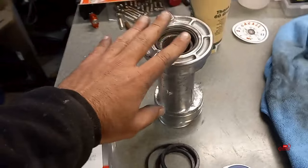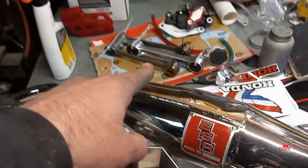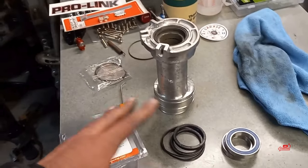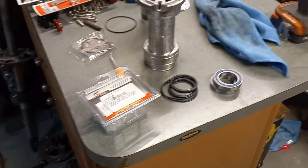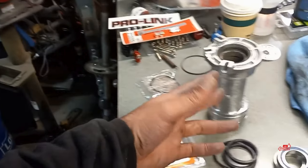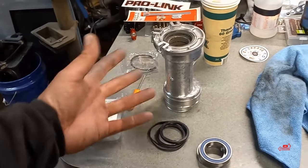Let's take a look at the bearing kit. I usually go with PivotWorks, but this is what I have. This is the All-Balls kit — KPJ10-06C or AB251320. This fits the 86 TRX250R, 300X, 400X, 350X, ATC250R, and all different kinds of models. I'm doing the frame swap on it now. I just finished making the shock linkage rebuild video, so check that out. I would consider this skill level one or two depending on the tools you have. I'm going to try to do it with just a vise, a punch, and a hammer.